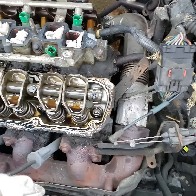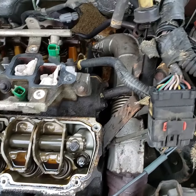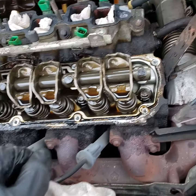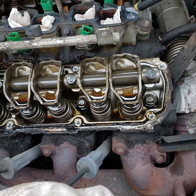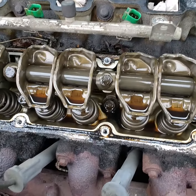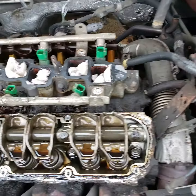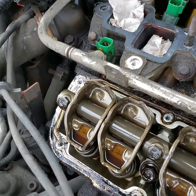As you can see, it was leaking all on this manifold here at the bottom, and in order to get to these gaskets you've got to remove that intake. Once you remove that intake, you don't have to remove the fuel rail, but you do have to unbolt it just to get enough wiggle room to get to the gasket. To remove this valve cover, you have to sneak it up from underneath — unless you're doing the lower intake, then you would have to remove the fuel rail.